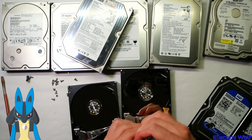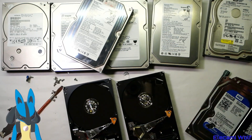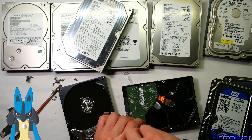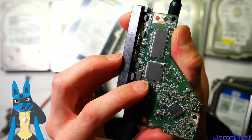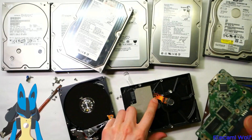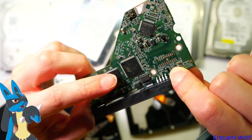You can get some quite strong magnets out of these drives, but I don't know if it's very useful. The head actuator would have to get taken out probably. Let's have a look at the circuit board. There's a Micron chip, Winbond, and a Smooth chip — that is possibly a motor driver since those are the pins that join onto the motor. And the head joins onto those contacts there, which are tarnishing quite a bit. And that would be the cache memory there.